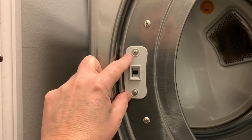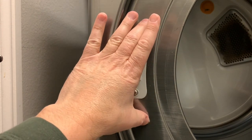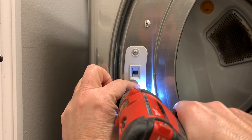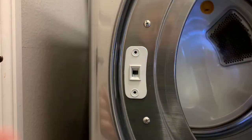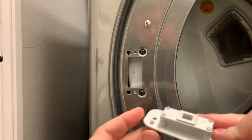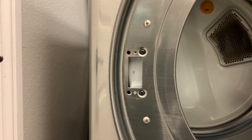So I'm going to remove these two screws and take out the latch. This screw and this screw are just decorative on this side. This is where the hinge from the door will sit into these other screws. So let's take these apart first. This latch is all plastic, so if you're using a driver like this, make sure it's set on a low torque setting so we don't crack anything. That latch pops out like so. It does have a little nub here that sits in that guide hole, and this is exactly the same setup on either side intentionally so that you can reverse the door.